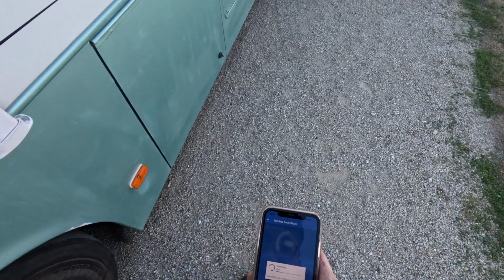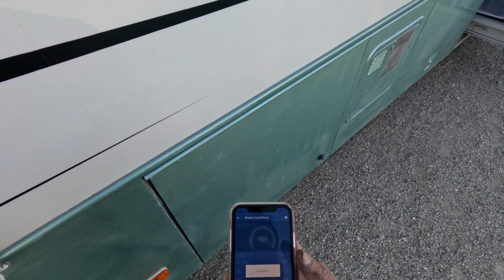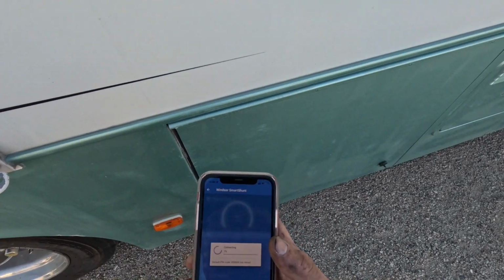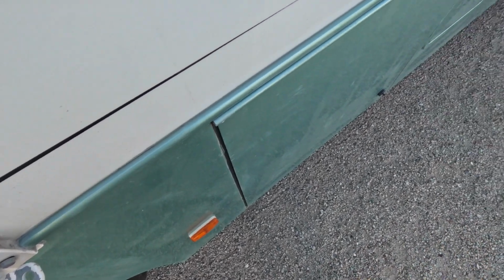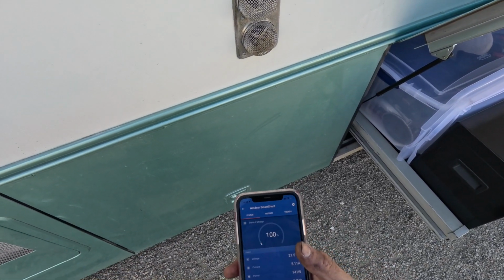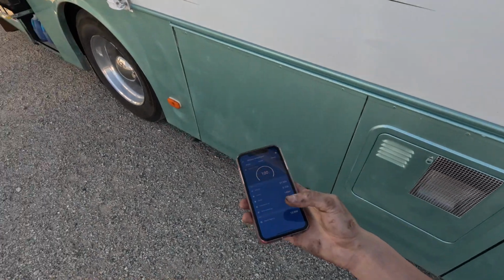Okay, select to my shunt. I have the Victron shunt configured so that the aux line reads the start battery voltage. So I should see like 14 volts also. Let's see if that's correct. Yeah, 13.93 volts. That's pretty strong.